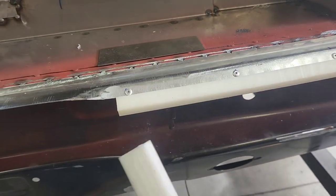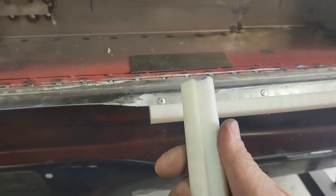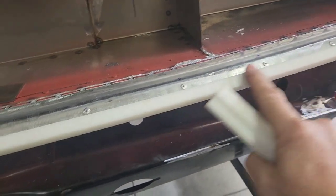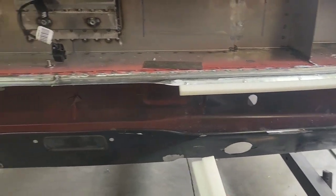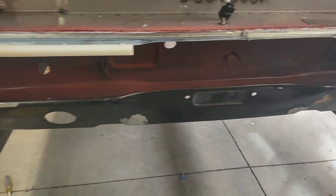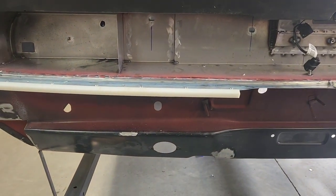What I really want is the top of my sheet metal bumper to be separated by about an eighth of an inch above that rim. So I've added a piece of Delrin - it's like a nylon material, you can mill it, available from McMaster-Carr in sticks, rods, or sheets. This creates a buffer and damper between the two sheet metal pieces so you don't get vibration. I'm also going to add my tie-in structure down on the existing roll pan for a bottom attachment point, plus plates for the bumper extensions.